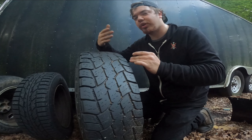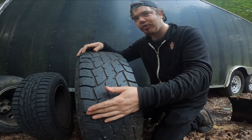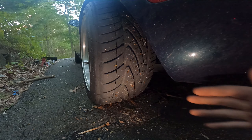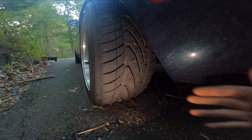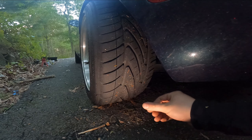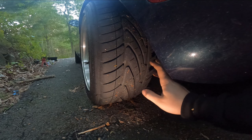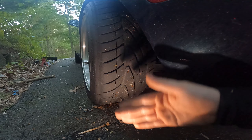Moving on — this is a winter tire, the exact same sizing: 185/60. As you can kind of see the differences, winter tires are designed with much deeper grooving than all-seasons, as these are only designed to be driven in the winter. Their whole goal is to get as much snow evacuation out of the way so that you're driving nice and deep onto the actual road and not floating over the snow. Certain snow tires like these have little spots for studs — completely optional, it helps on ice. These tires are usually softer than an all-season, which helps them drive in the snow better. They'll get less MPGs if you drive them in any other season, and they produce a little more road noise than an all-season. These tires are built for one job specifically, versus the all-season being an all-year-round tire.